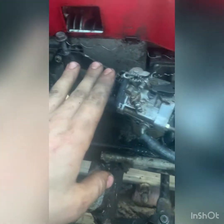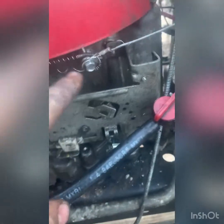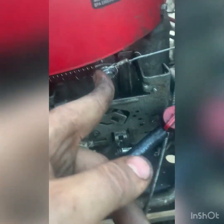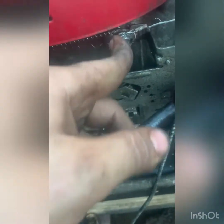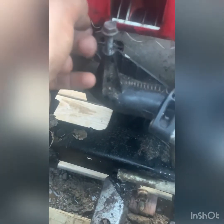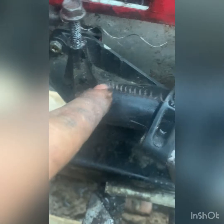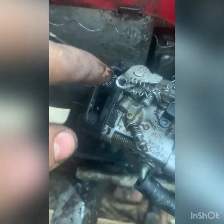I'm gonna show you what I did. I have a heavy return spring going from this — which is the McCulloch governor arm — a return spring going up to there for returns. Then I have another return spring going — I drilled a hole through here — going up to here, right there.